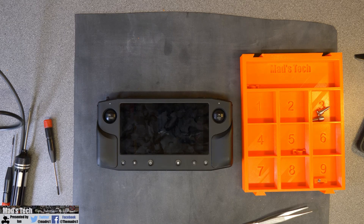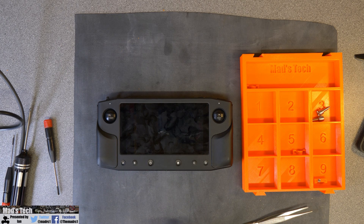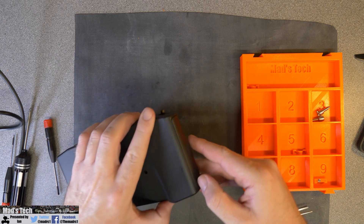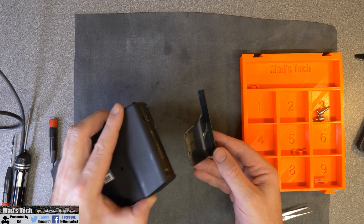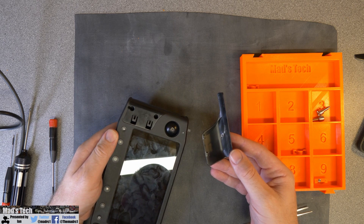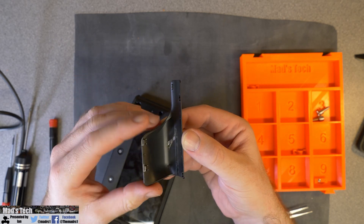The first thing we need to do is remove the two grips on the side of the remote. These are held on with little plastic clips as well as some adhesive tape. To remove these you need to push them outwards away from the remote. The easiest way is to prise it open from the back on the side and flip them upwards. These clips are just holding clips — not proper fitting clips — so you do need to be a little careful, but they will just pop free.